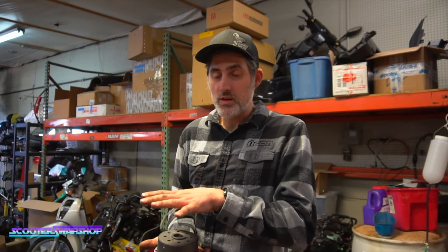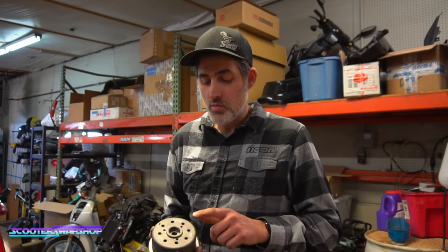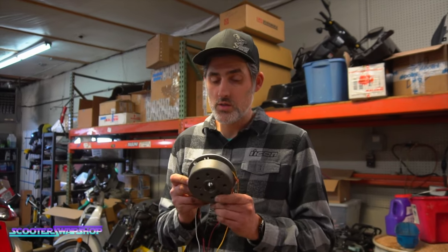Now that the ignition is good with the stock one on, I'm going back through and jetting it, because now the jets are giant, since the jets were huge to cool the bike due to the detonation. So keep in mind, if you have a bike that's running advanced like this, you will blow up your motor. It's just a matter of time.